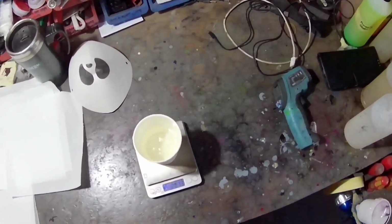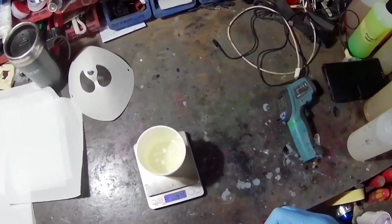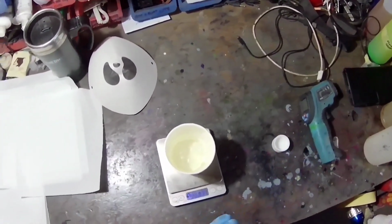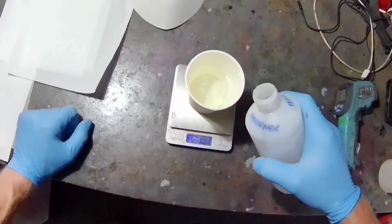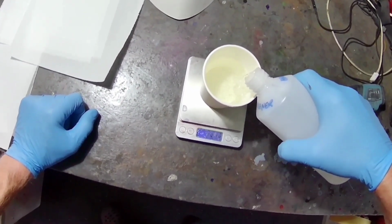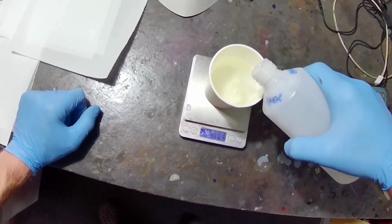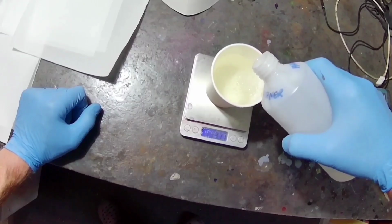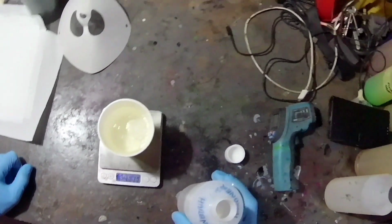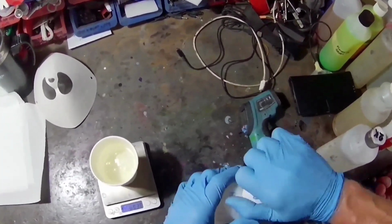Although if you're doing what I'm doing here and you're going to sand it afterwards, then you're probably better off using what I would normally do if I wasn't testing this tip. I would normally use something like the U-Pol clear coat. It's quite a cheap clear coat. Put 2 or 3 good coats of that on, and then sand it nice and flat, and then do your artwork. As I say, I use the term artwork very loosely, but do your decals or whatever you need to do if you're spraying them on with an airbrush, and then you can normally just put 1 good coat of clear.